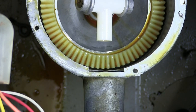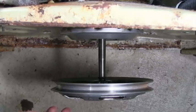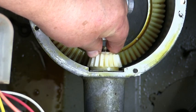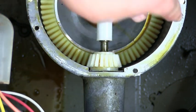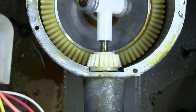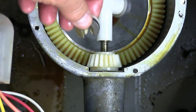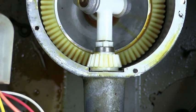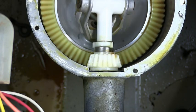Put the little plastic gear in place and hold it. Push the bottom transmission shaft all the way in so you can install the holding clip. Grab the holding clip with the metal part facing down toward the transmission and push on it until it clips on. Turn the transmission pulley counterclockwise to make sure that the transmission is doing what it's supposed to be doing.